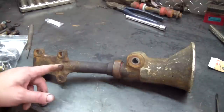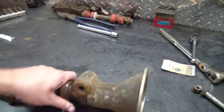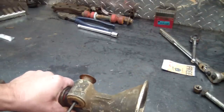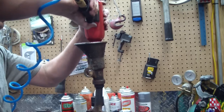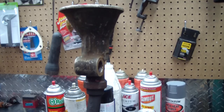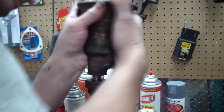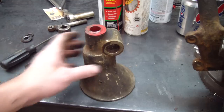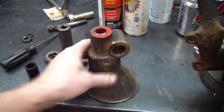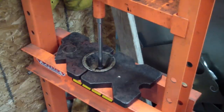Here is the trunnion — I guess this is the upper and the lower part. I do have a bearing kit here. There's a bearing in it right here, and in the kit there are some bushings for this mounting point. Here it's in a vise — you can see it swivels. There's a nut inside there. I'm going to take that off and see what we have underneath. Here it is on the bench — you can see there's a bushing that goes up through the center of it. The kit did come with a new one. There's a little bit of ovalness to that original bushing so I decided to go ahead and change it out. This is the setup I'm using on the old press.